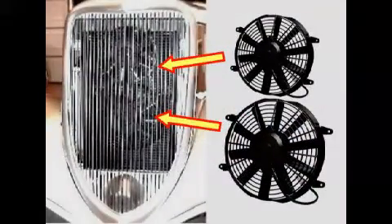With the small space available in the '34 and the vintage air condenser covering the full radiator, I decided to add electric pusher fans in the front of the condenser and radiator. The 10-inch fan fit at the bottom, but reduced clearance at the top allowed only an 8-inch fan. Since hot water enters the top of the radiator, a fan at that location is most effective.